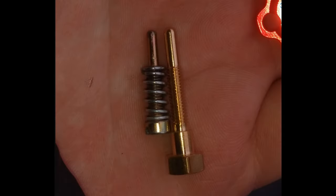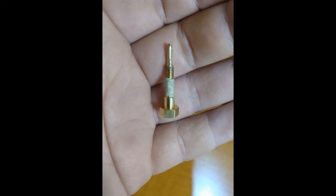I do have two photos from when I did this. The screw on the right is from the nibby carb, and the shoulder — that smooth part — the diameter of it is 2.8 millimeters. You're going to want to shave it down to 2.2 millimeters in diameter. The pz20 screw on the left has a smaller shoulder. You kind of have to look carefully, but there is a size difference — a little bit over half a millimeter.